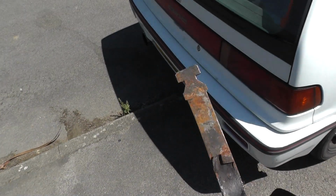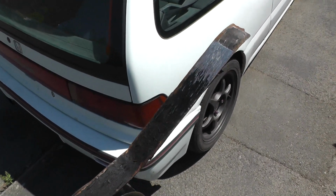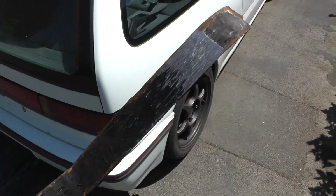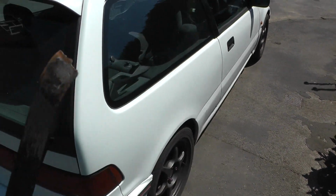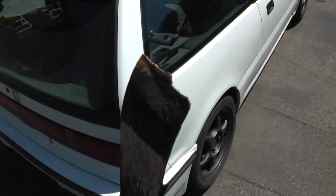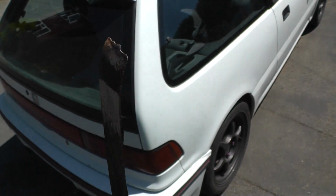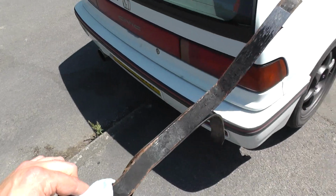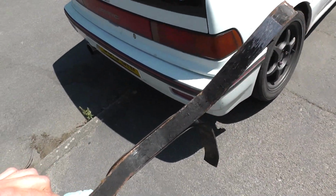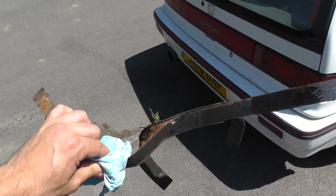This is the strap in question. You see that side is the side at the front that stayed, and this side it fell down. I couldn't stop straight away, so you see it's rubbed quite heavily, but what happens is they just get corroded, get weak, and then basically fracture there. And this is what causes the strap to come down, but it's actually the second one that's come down so far. I think I've got another one, and I know that MB6 ones for a start work.